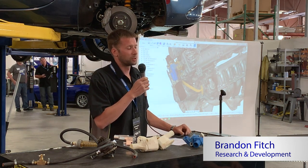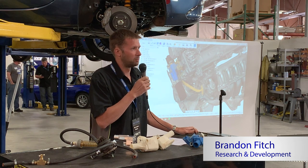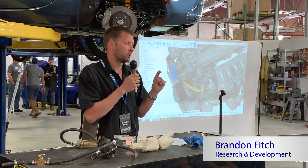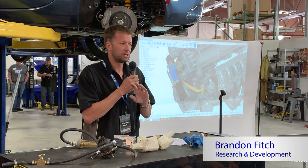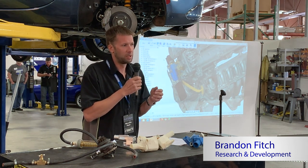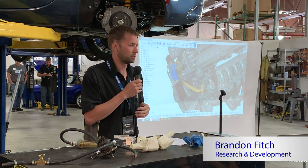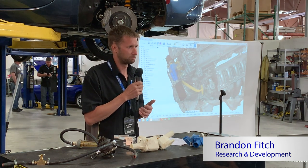So the question is, did the Mazdaspeed head gasket change that situation? I think it's actually the 01 head gasket where they made some changes to the different sizes. My understanding is not great, but they're kind of band-aiding it, and from what I have gathered from other people, it's maybe better, but it does not solve the problem. The routing is still the same. And you can use a reroute on a car with one of those head gaskets. If you have the head off of it, go ahead and put a normal 94 to 99 head gasket on it. But if you have one on to start off with, it shouldn't make that big of a difference.